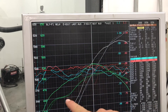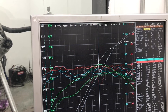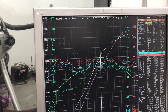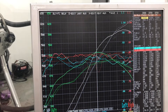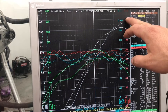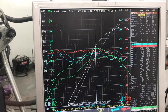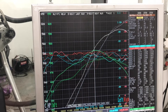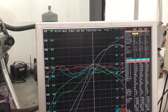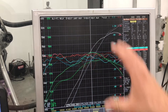Keep in mind, guys, you spend more time in the low and mid RPM range than you do up top. So the longer-runner intake is a big benefit. For a boosted application, we think the FAST intake manifold might be the one to choose for this specific application, but unfortunately we didn't have one to test.